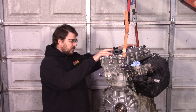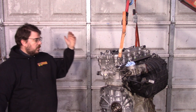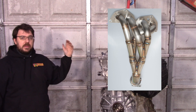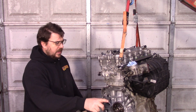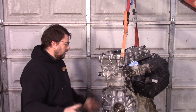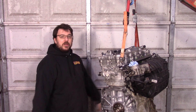The exhaust side, if you can believe it, is actually even simpler. I just took my third gen MR2 swap header — used exactly 100% as-is — and then about eight feet of two-and-a-half inch pipe, and somewhere towards the end of that there's a two-and-a-half inch straight-through muffler. That's it. That's all it took to make 240 horsepower.